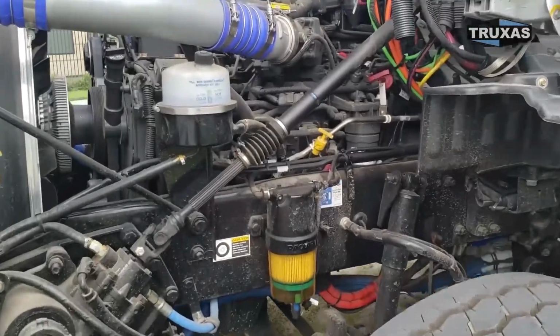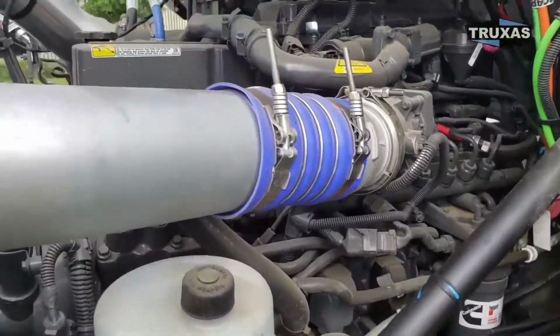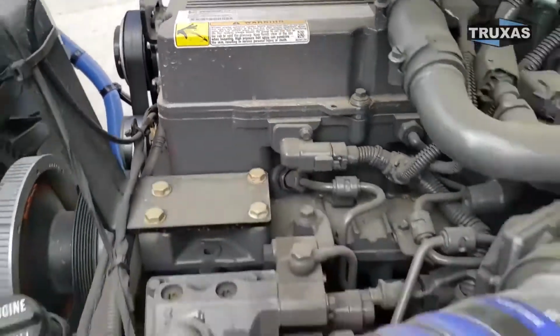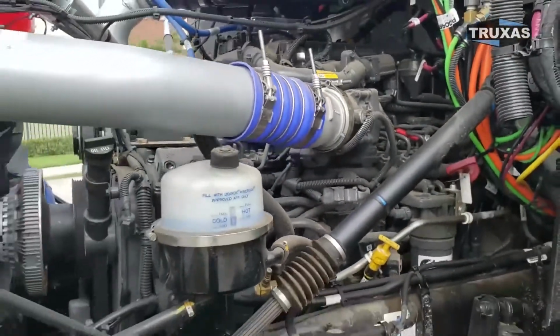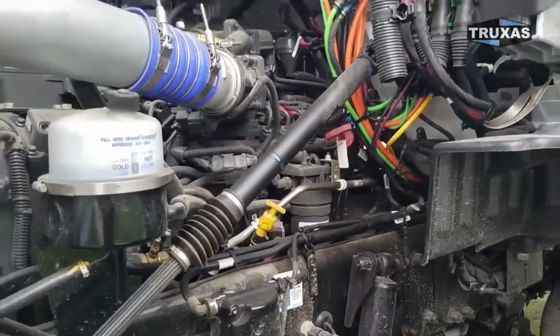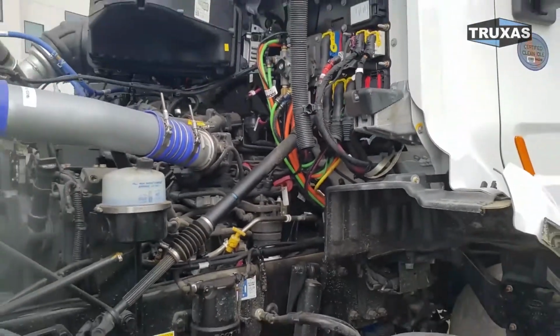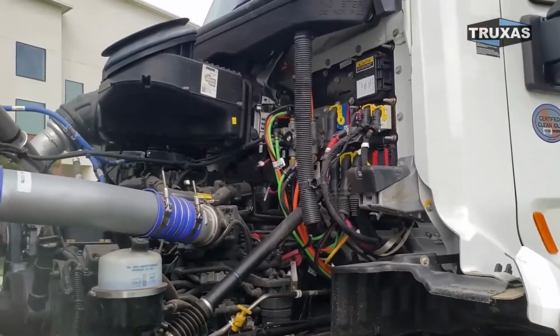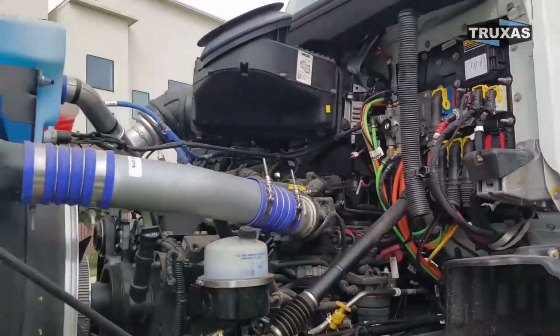they're set up. So this is the PX9 that's in these, set at 370 horsepower, as you can see. Any higher than 370, then they recommend a bigger Allison transmission. So that's why we got them set at the 370 horsepower, which is plenty to move 60,000 pounds all day, every day. This is the same engine as the Cummins L9.